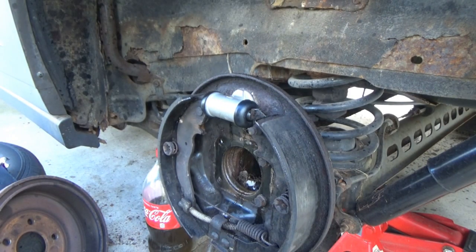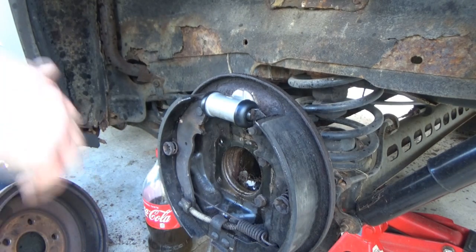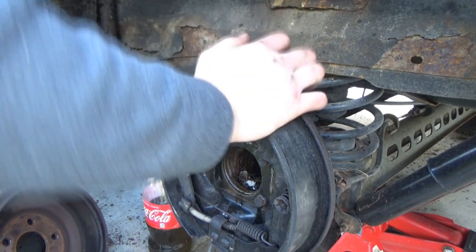New wheel cylinder is in place. Now we just have to tighten the line with our 9/16 wrench. When you put the line in, make sure it doesn't cross-thread. Make sure you snug this up pretty good. That's pretty tight. Now for the grand finale — which should have been the only thing on the video, but didn't turn out that way — and that is our hub.